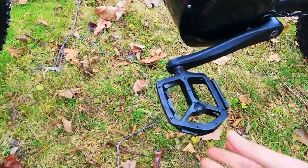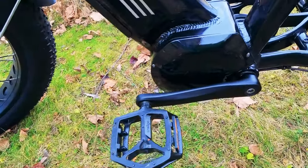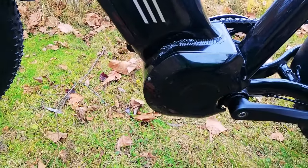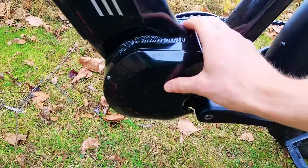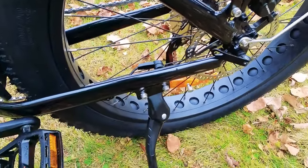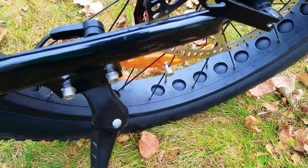The bike comes with Welgo metal pedals, a brand we see on almost every single electric bike. You can upgrade them if you want more grip or additional color. This is a mid-drive electric bike — the Bafang BBS02, 750 watts nominal and 1,000 watts peak. You can see the frame is really built around this specific motor, and there are screws in case you ever need to remove it. Moving on to the rear of the bike, it has a quick release, a nice burly kickstand toward the rear, and a speed sensor magnet.